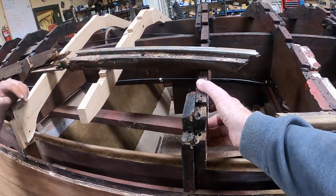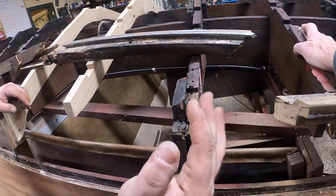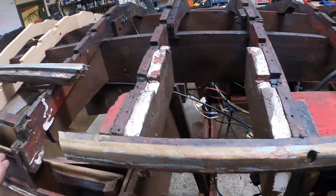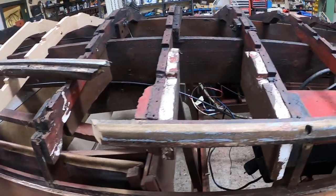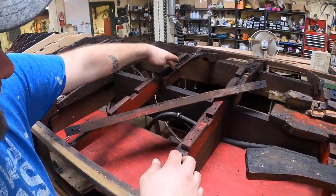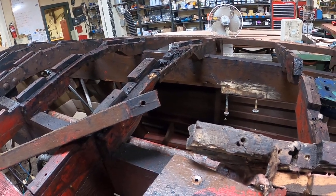Joe, what do you do right here? This one must be replaced. What do we do right here, because I don't like what I see? I'll check and poke through it to see how much rot is in it, and I might be able to cut out a good portion and put a sistered Dutchman in it with another frame underneath. And this one, as you can see, it's brittle, it's crumbly — it should go. That wall had to be replaced as well. You haven't had the pleasure of ripping these two hideous things out yet? There were actually several of them — you're halfway through. And obviously, right where the engine was sitting, this is probably the worst of it. When you can take your finger and get oil — even your nail just fills up with oil. Hey, here's another repair: somebody took a piece from an erector set and screwed it on to try to hold that together. That is rather beautiful.